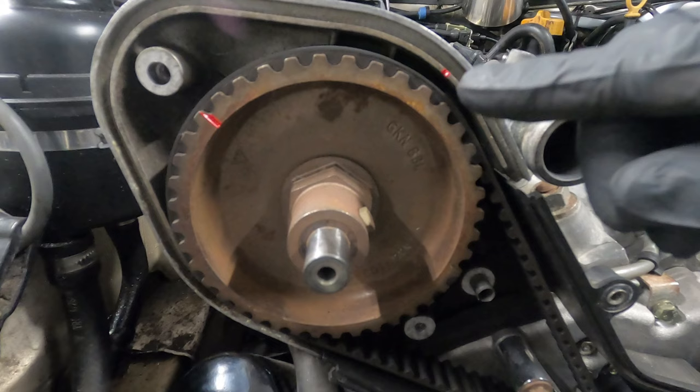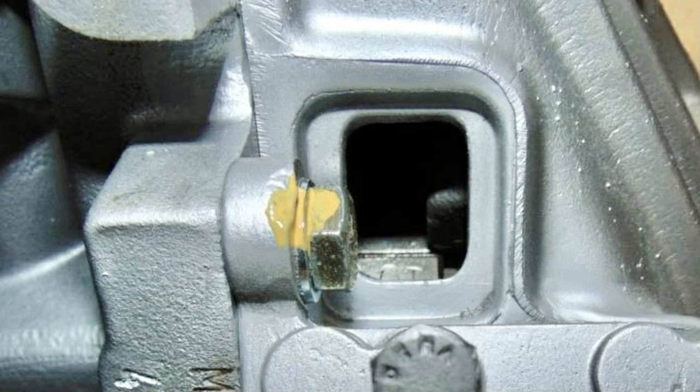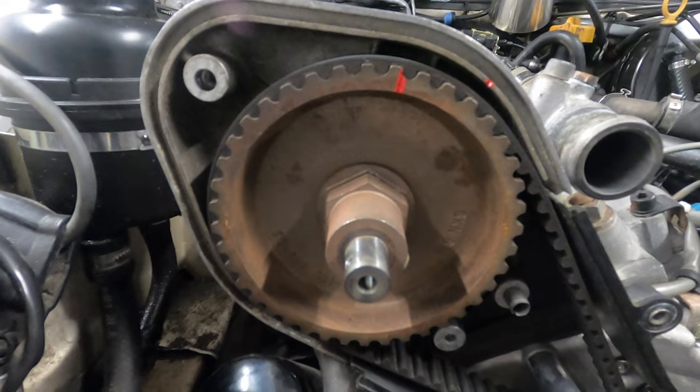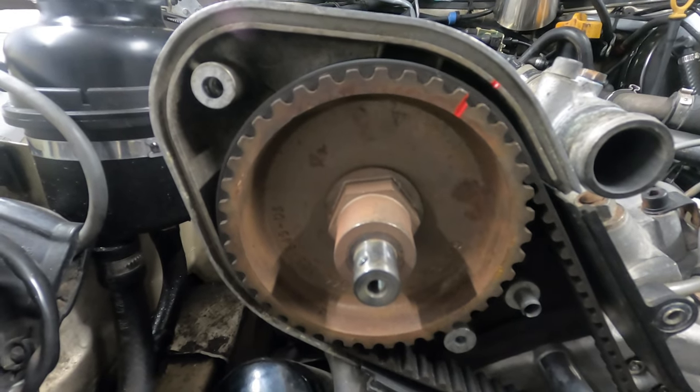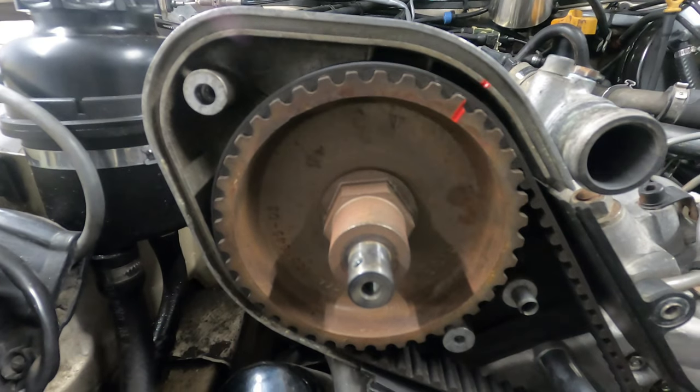We'll use the camshaft gear as a guide, and as the alignment marks get closer, we're looking for the letters OT to appear on the flywheel through the window opening on the bell housing. Stopping when the alignment marks on the flywheel match the alignment tab. At that point, all marks can be double-checked and the flywheel lock installed in the location of the starter mount.